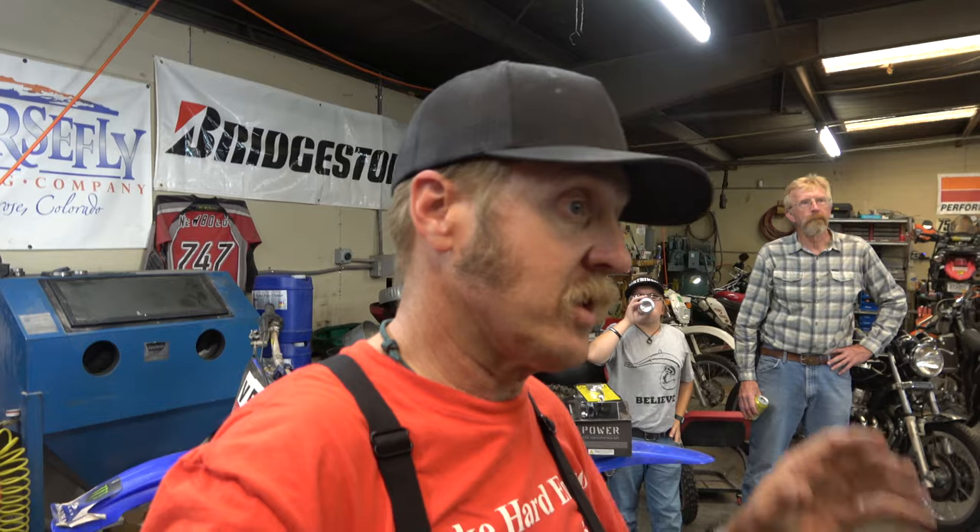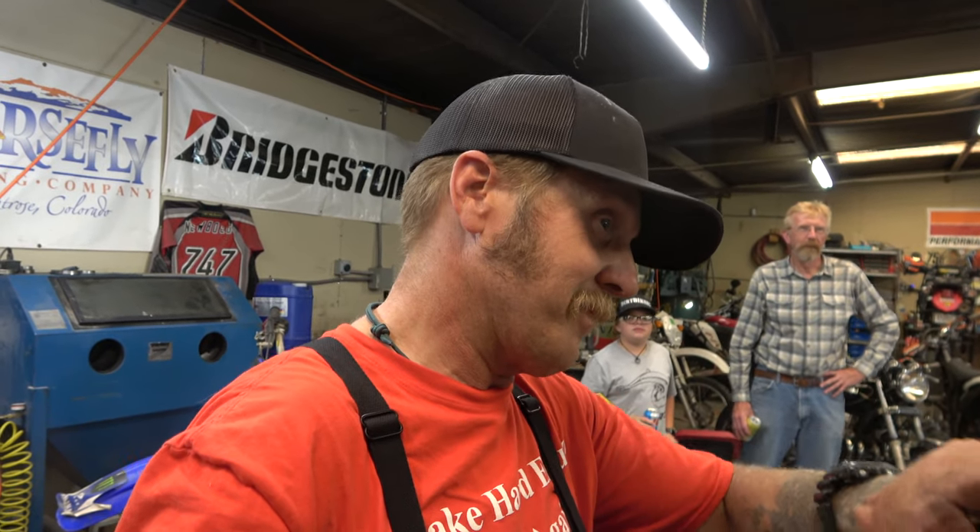He'll also be paying for everything. So we're going to pull it apart and find out how bad it is. It was still running, which was good — ran back to the truck, just not very well. It would start, actually started okay, just no top end. Lost compression, rings are probably junk. I'm guessing everything else is okay because I looked in the cylinder through the exhaust and it actually wasn't terrible. So let's take this thing apart.